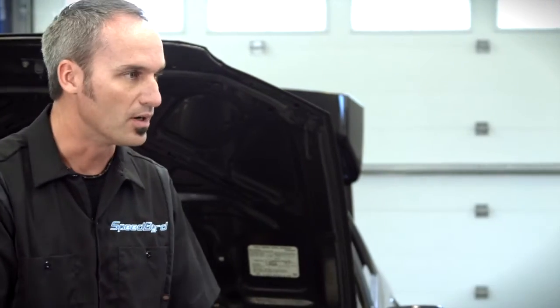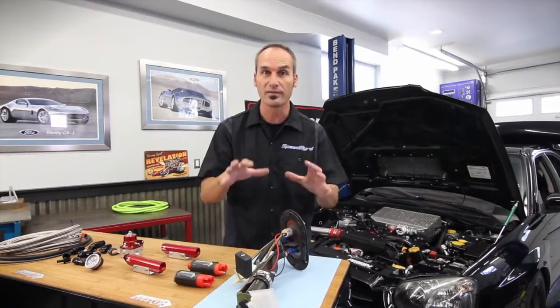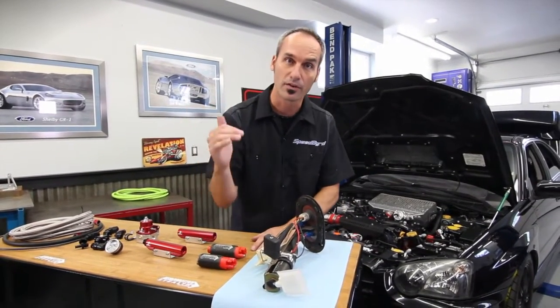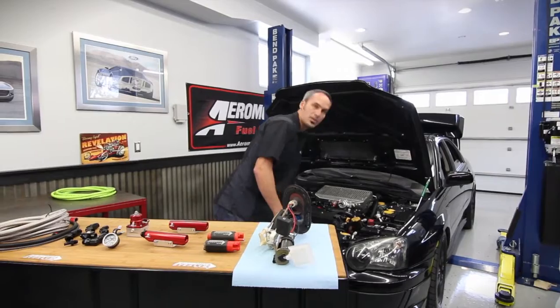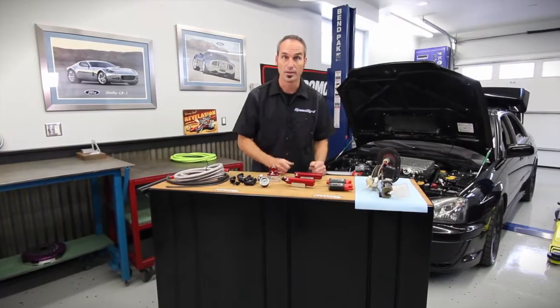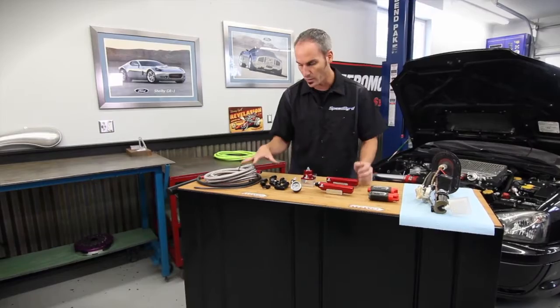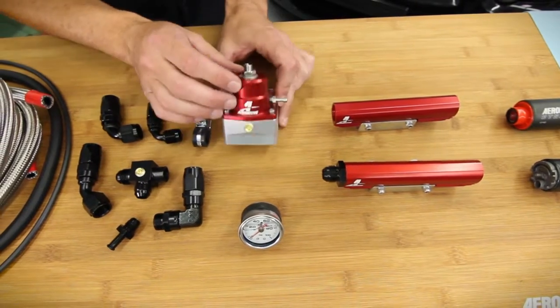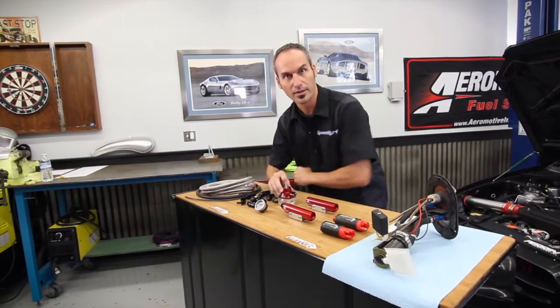You're not going to make horsepower with just a pump — you're going to have injectors because they're going to restrict. This pump started out 130 liters per hour; 155 liters per hour with the upgrade. Now I'm at 340. But injectors, it's the same thing. So we're going to pop the two injectors off of this side, pop the other two off of that side, upgrade their flow capability so we can get the fuel into the engine. You're already pulling the rails, so why not pop on some new billet, higher flow, better capability rails with all the fittings, along with even your high flow pressure regulator. This is going to help dampen all those pulses in the system so each injector sees a solid pressure across that whole rail. And you want to monitor it — plug this guy in, it comes with the kit. This is their equalizer — a liquid-filled fuel pressure gauge.